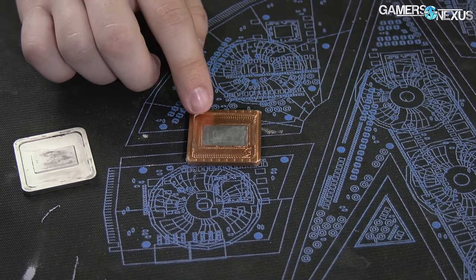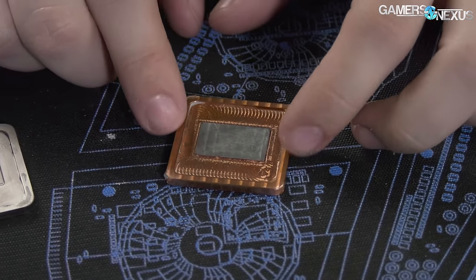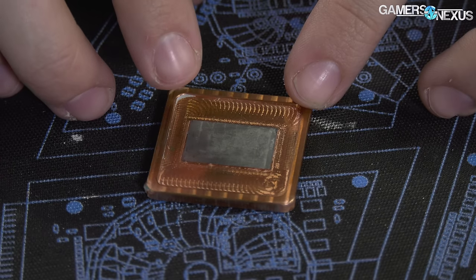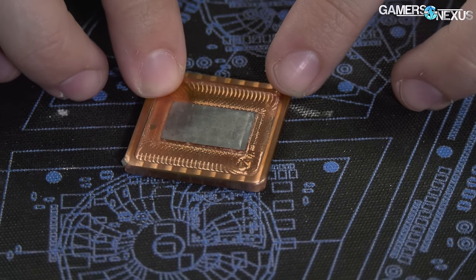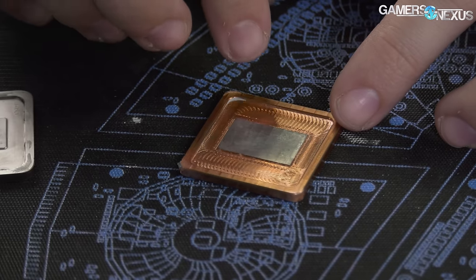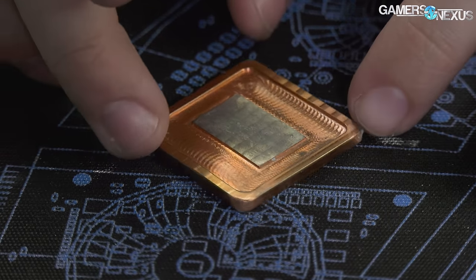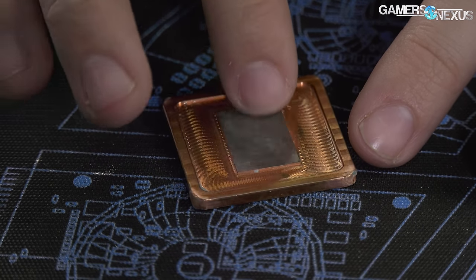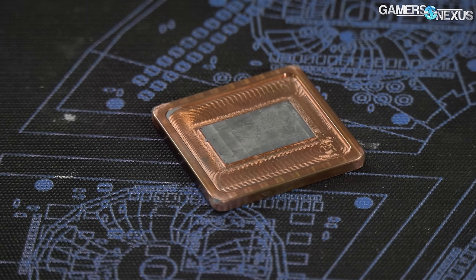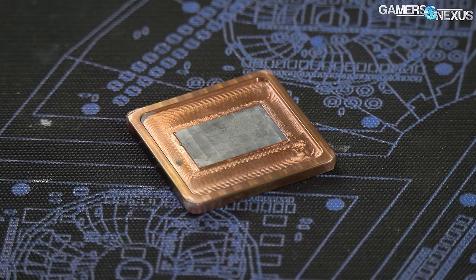What's happening is there is a difference in potential between the liquid metal, which is a gallium compound, and the surface of the IHS. Here it's bare copper with no nickel plating. What we're getting is ion migration, where the liquid metal applied to the CPU die causes some gallium to slowly migrate into the copper surface, which causes a stain. Functionally your performance is pretty much the same — you've essentially just plated it, and it's still a smooth surface. Thermally it's fine; performance isn't really any different. If it bothers you, you can try to clean it off, but the chemical properties mean it's pretty permanently plated at that point.